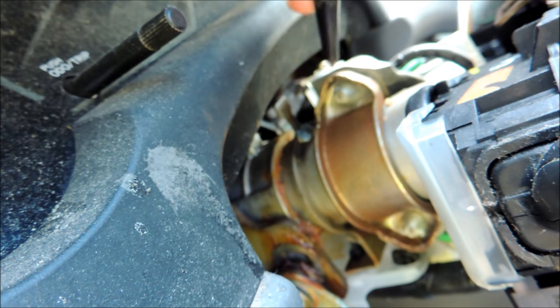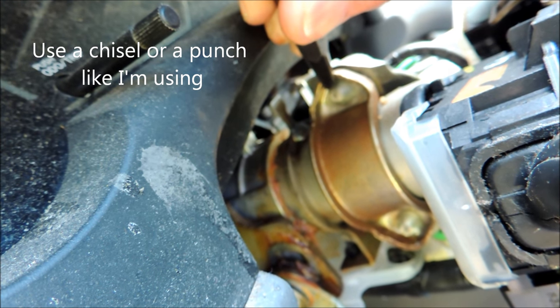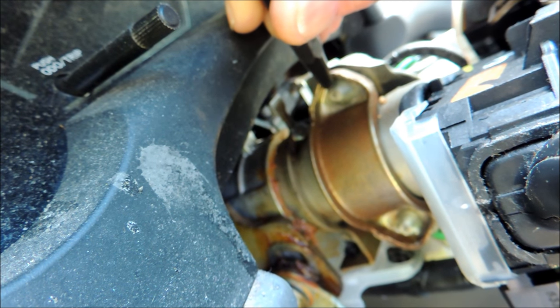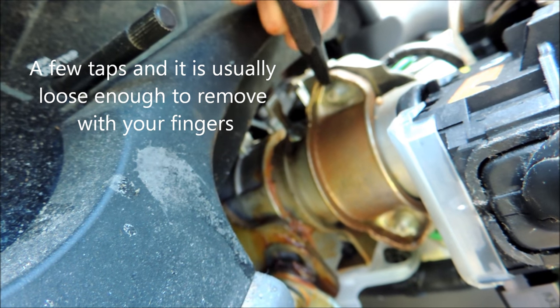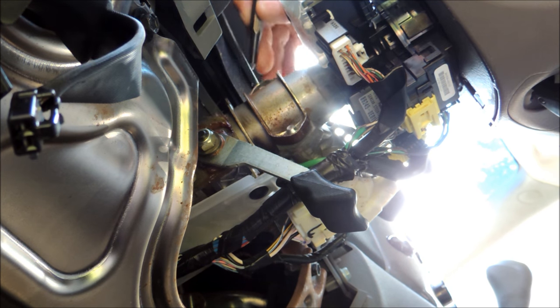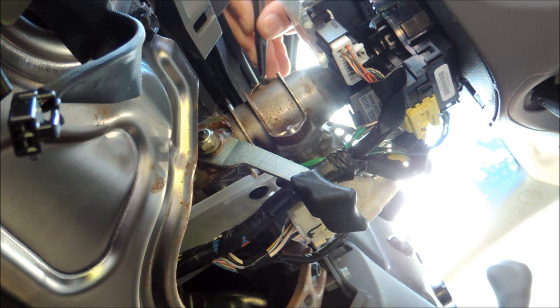Notice these bolts — they're security bolts, they have no head on them whatsoever. So how do you take them off? Get yourself a nice sharp chisel, get it in there, and start tapping a little. You should get it to turn a wee bit and loosen it up. After it's loose, you can get some small pliers and fiddle it out. Picking at it seems to work — once you loosen it, it's easy to get out.